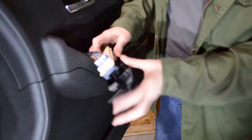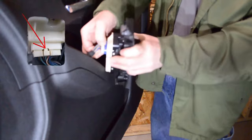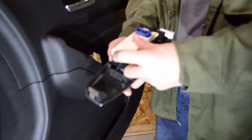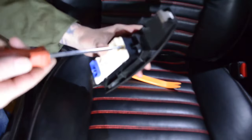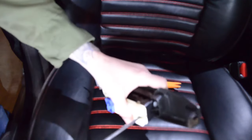Next, all we want to do is remove this wired clip by pushing in on this tab right here. Now with that out, we're going to have to remove this screw and this screw and then we can pull out the old switch. So we're going to take our Phillips head screwdriver and just unscrew these two screws.